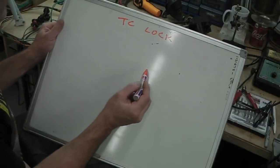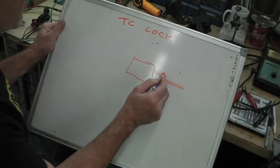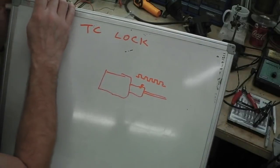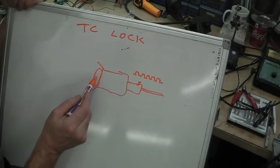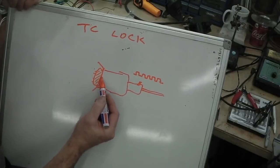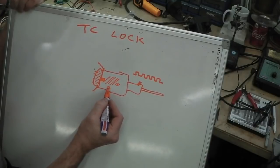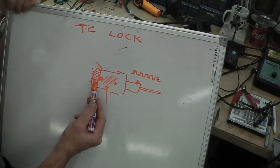Okay, you've got your gearbox, you've got your output shaft, you've got your prop shaft, you've got your speed sensor just in the tail section. That's the sensor which creates these pulses shaped like this. We've talked about them. Going to be used for the cruise, going to be used for this lockup converter. Here in the bell housing, just inside, there's your torque converter fitted into there, bolts onto the flex plate on the engine itself. Spins round as torque converters do. I'm not going to explain the exact workings of a torque converter, but suffice to say, on the side of the gearbox is a little 2-pin connector, so you've got two wires coming off it, and they're the wires that switch the torque converter lockup on.